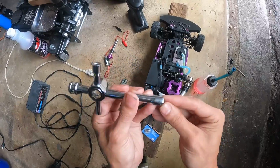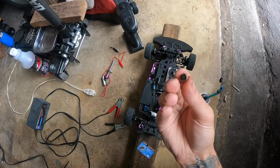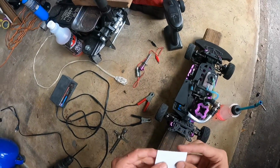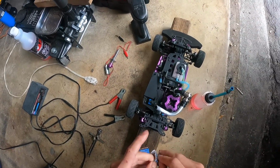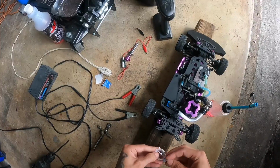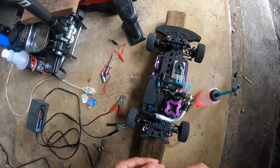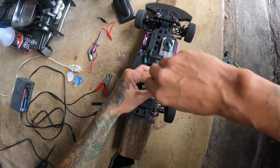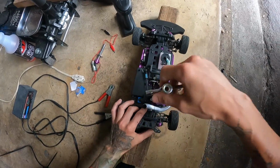We'll put a fresh glow plug in it, because if you guys didn't watch the video when we first drove this thing, that glow plug is burnt up, and I'm not really sure if the car is running lean or rich. Everyone I ask, it's like a 50-50 split. I have people swearing that the car is running rich, and then I have other people swearing that the car is lean. I've asked 10 experienced people their opinion. No one seems to know 100% what's going on with it. So we're just gonna put a new glow plug in this unit. Hopefully we can get it to run long enough to test out the new turbo kit.